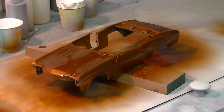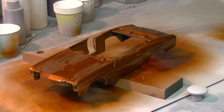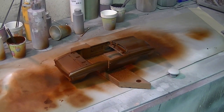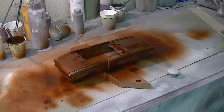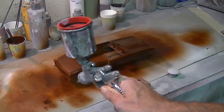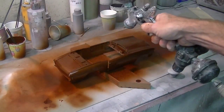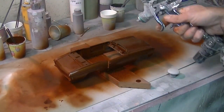It looks nice and wet and glossy. It's still a little bit transparent at this point — you can still see some of the primer here and there because this was only our first coat. In this shot I'm coming back with the final — third — coat. I went over it with my tack rag again to make sure there wasn't any dirt or debris. You can see the paint has actually gotten a little bit darker too in this shot because we've finally gotten it covered up and we're not showing any primer through it anymore.